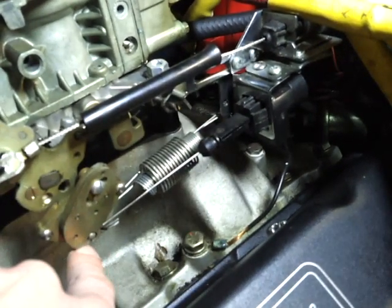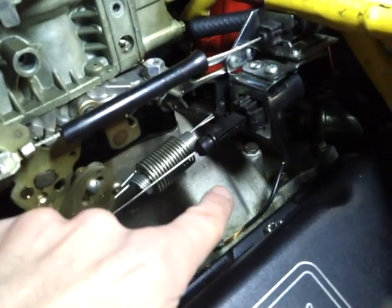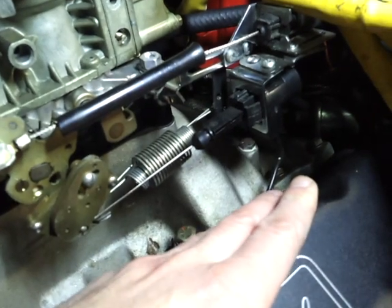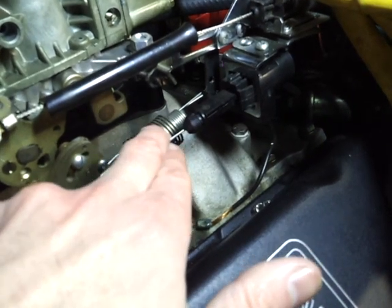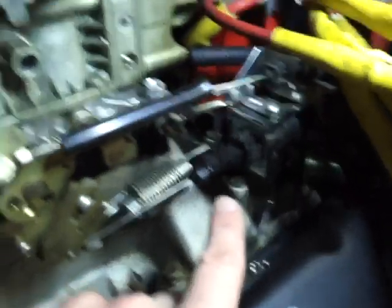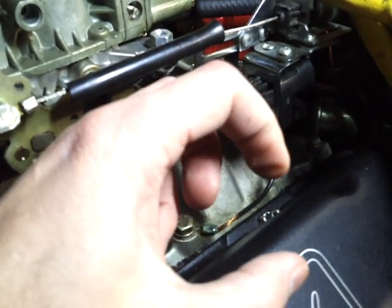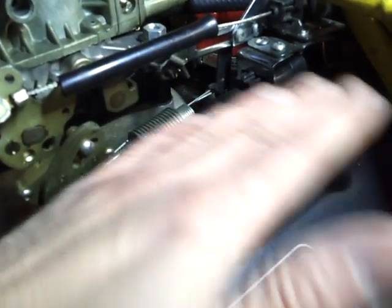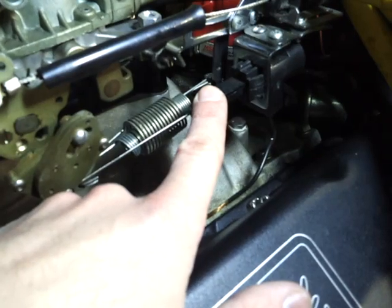Once you do that and you're all the way at full throttle, the most important thing to know is there's a throttle valve plunger inside the transmission that this cable pulls inside the valve body, to allow the pressure inside the transmission to flow through. What basically happens is this controls the shift points of the transmission. This is also in competition with the governor in the transmission. A lot of guys in 700R4s put Corvette servos and Corvette governors. The Corvette servo is a better servo that makes the transmission shift harder because less fluid goes past it — but that's another video altogether. The governor is in competition with this throttle valve cable to control the shift points.